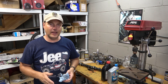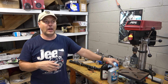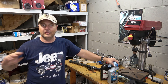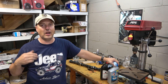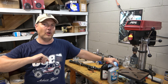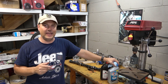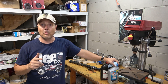And that's all I got for now. If you've got an old motor, an old design — and when I say old design I mean pre-OBD2 — your Porsche 944s, small block Chevy, small block Fords, five-liter Mustangs, old MGBs, Triumphs, Datsun Z cars, your Jeeps, Jeep inline six motors all the way up to the end of production in 2006 — they've got to have this zinc in the oil or you're doing damage to the motor. If you like this content, hit the subscribe button and the bell icon so you know about future content coming up.